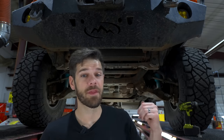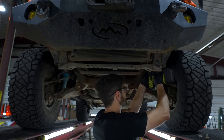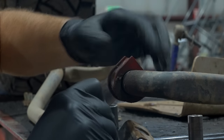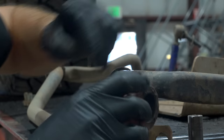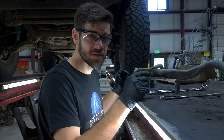I realized that my King's remote reservoirs have a different sway bar drop kit that shifts the sway bar slightly forward. Since this is a prototype kit, parts may change in the future. I also took off my sway bar bushings — mine are polyurethane. One of my patrons who built race car suspensions told me polyurethane bushings can cause more harm than good, and I've planned to use rubber on my next build. I also have aftermarket sway bar bushings, so I wasn't sure how the system would line up with my particular application.